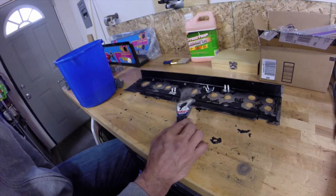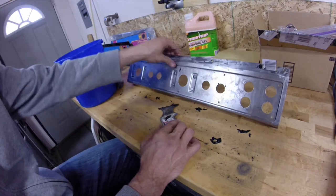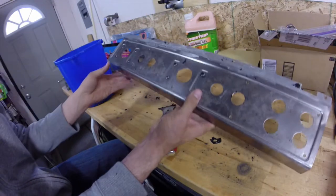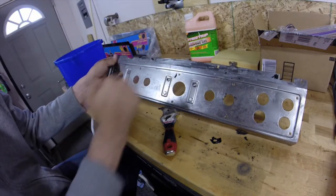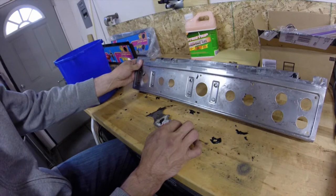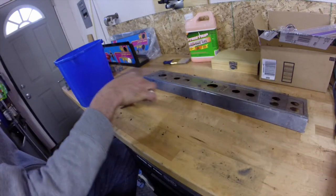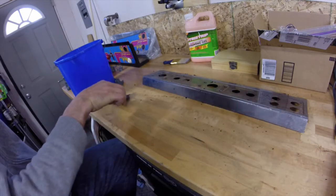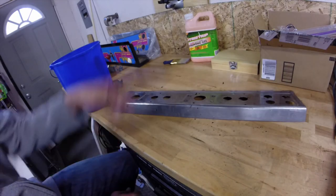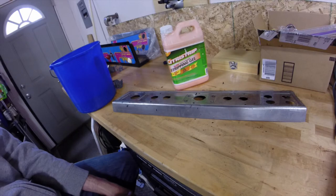Generally this panel is pretty straight — I've got a little bend here that'll need to be straightened out, but that's pretty minor. The other one had all kinds of divots from people smacking it with something, and I just took a ball-peen hammer and a mallet and tapped those out to get them nice and straight. This one's pretty good. So that is stripping a panel. Thanks for watching this relatively short video on stripping control panels using citrus strip — and time is the biggest tool to use here. That's all I've got, cheers.